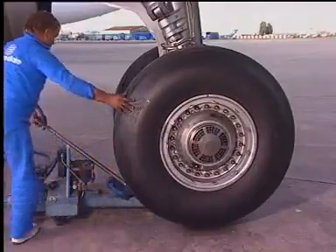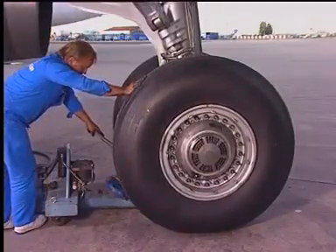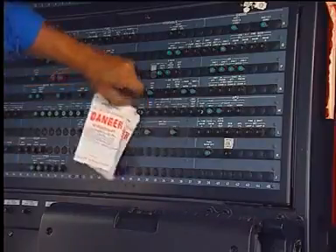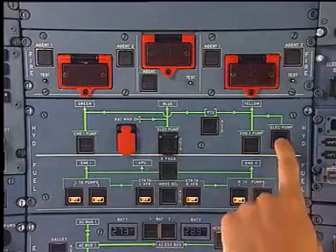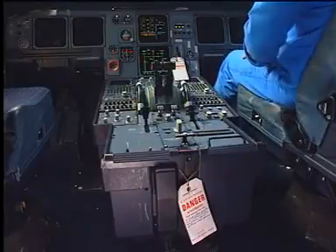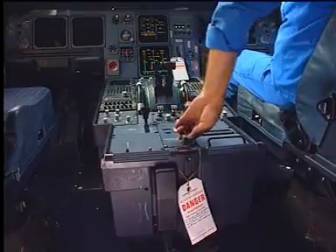Make sure that the area is clean. Lower the landing gear. The tire pressure being previously checked and adjusted, remove the jack from the landing gear dome. In the cockpit, remove the tags and close the circuit breakers. Select the ECAM hydraulic page and pressurize the green hydraulic system. Press the braking pedals. Check the forward coupling for any leakage. Apply the parking brake and check the pressure on the triple gauge indicator.